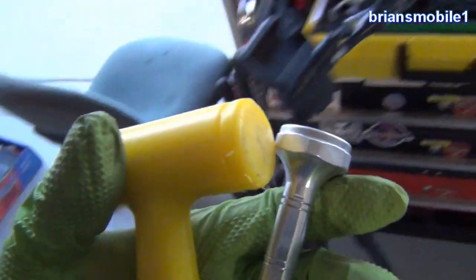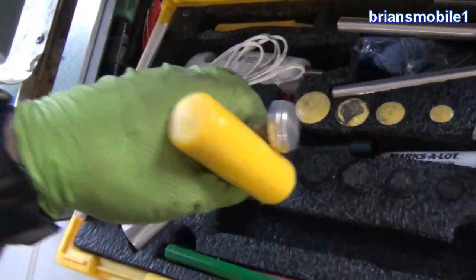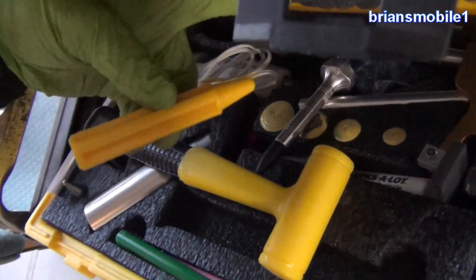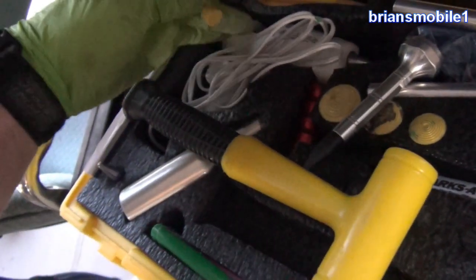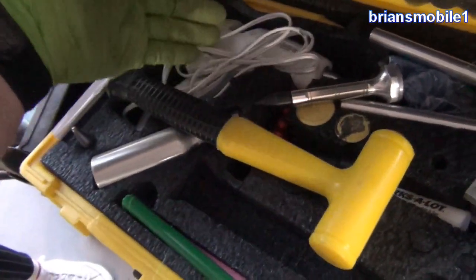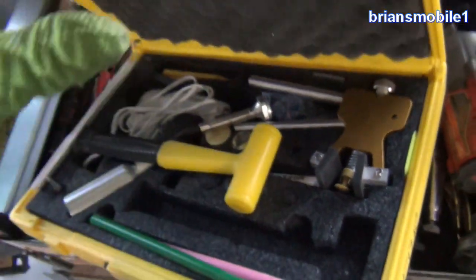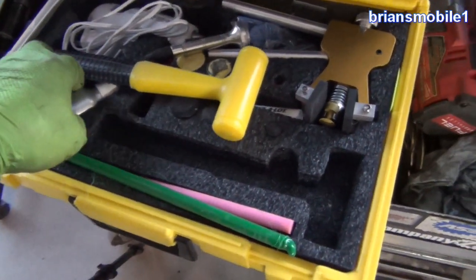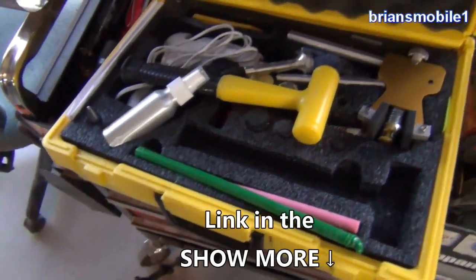This kit is not very expensive. These are the special glue sticks that come with it — this is a Cactus brand that professionals use, but there's all kinds of stuff that comes with it. I bought the glue gun separate because it's easier to control. The kit comes with tabs that you glue down, and this thing can lift up the dent. They have a 12-volt one, but I put in a 120-volt glue gun that works way better. It's called Fix That Dent — if you've got an old beater car to practice on, this is a great way to get started. It's got a little alcohol spray that releases the glue so you can pop it back off. I'll leave a link in the description below.